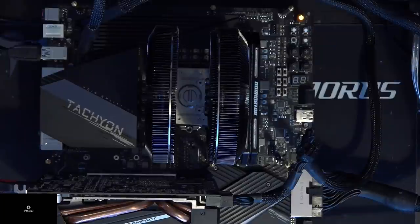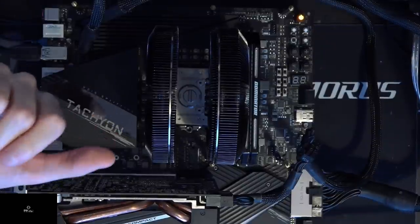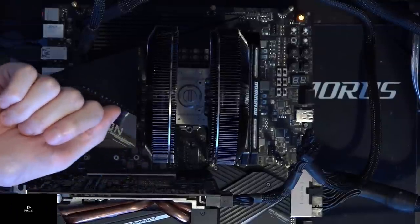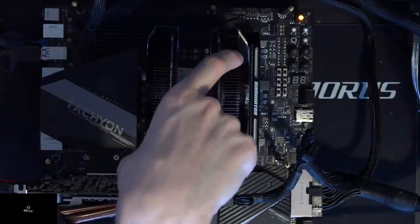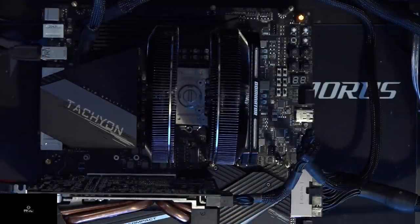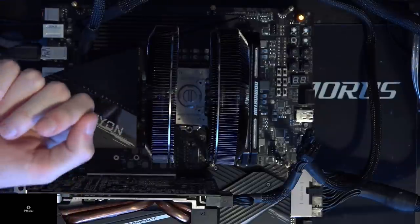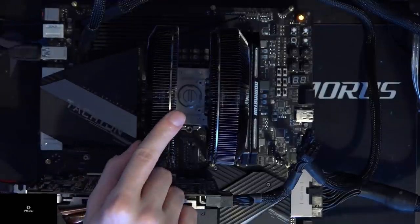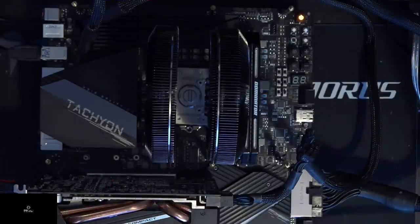Most AIOs and other air coolers don't have this style of mounting hardware. This still comes with a backplate, but the mounting hardware attaches directly to the heat sink instead of having a whole three or four piece setup — the important stuff is attached to the heat sink. If you were considering a heat sink for similar applications like binning Intel CPUs, it's worth noting this will actually go on X79, X58, X99, and X299 — the screws on it are M3 thread.